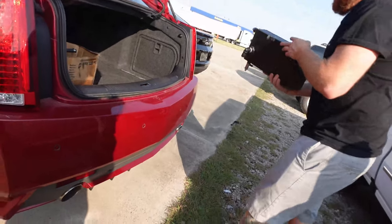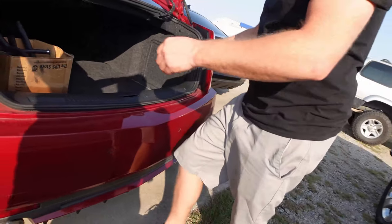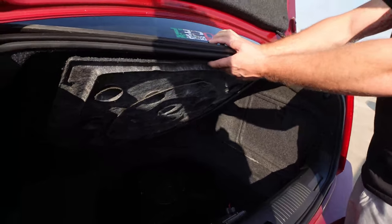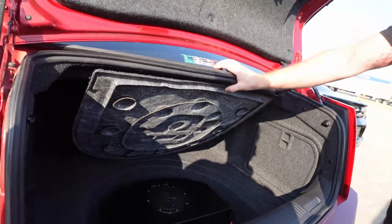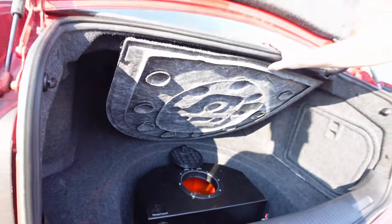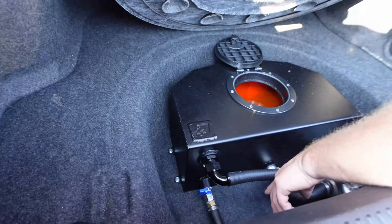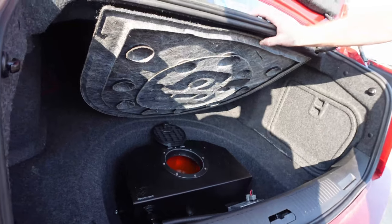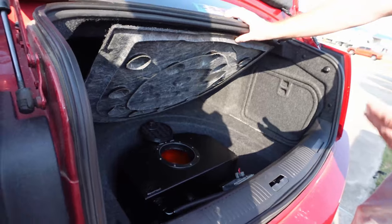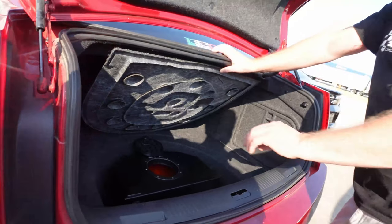So can you show me exactly how everything works? And another question — does ice break down the brick? So ice normally has some corrosive properties because it's straight water, it's hard water. If you're using a lot of ice all the time, you definitely want to add some coolant to help keep that corrosive property down. You've got a drain valve here — drain it down maybe halfway so you can put about 20 pounds of ice in it. If you're drag racing, it's best to turn the pump off when you're in the staging lanes and turn it on before you make your pass.